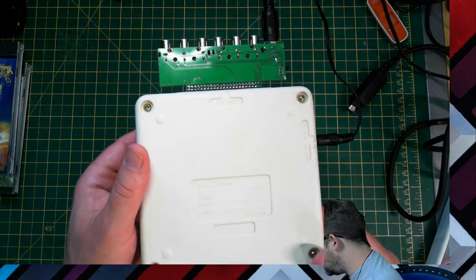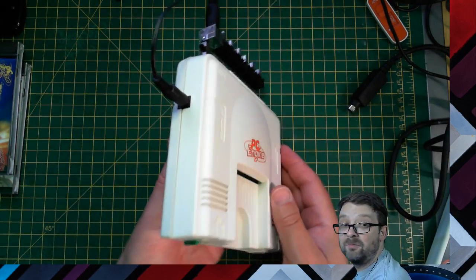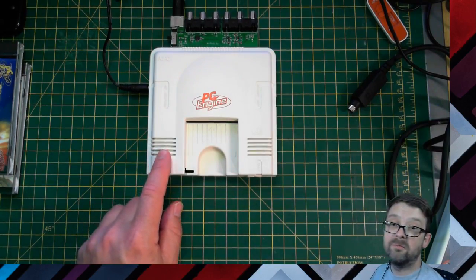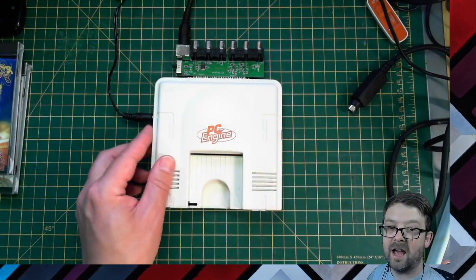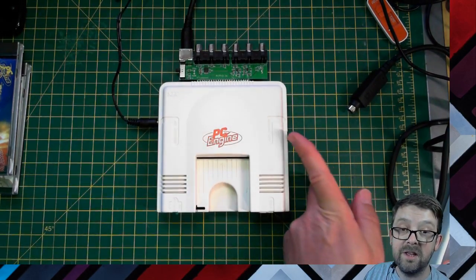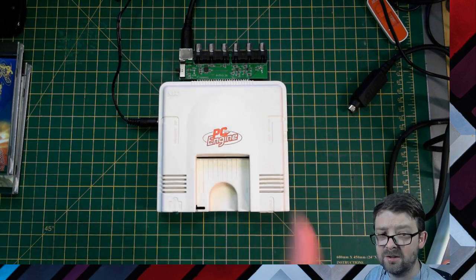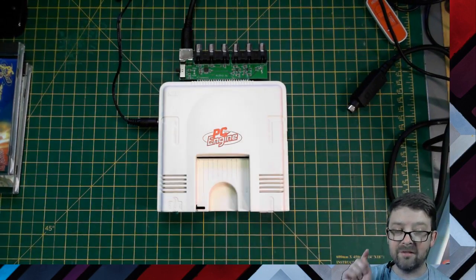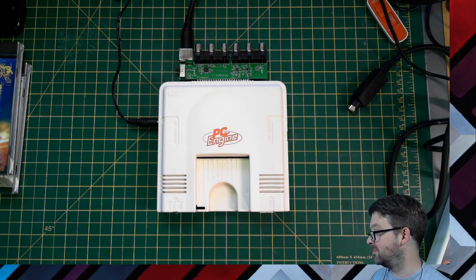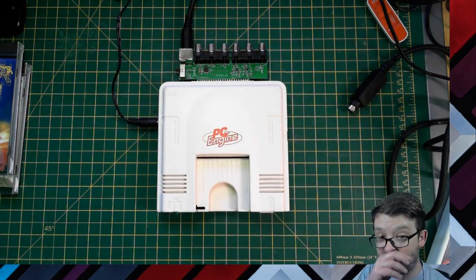Yeah, it's a 6001, so it's the first gen. And as I say, I picked this one up really cheaply because it was unable to test and it was grot bags. So I fixed it up, took off the horrible composite video mod that someone had hard soldered to the motherboard. There are various points on the motherboard where you can get stereo audio and composite video out. And they had just shoved the cables out the side.